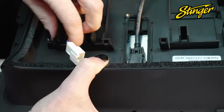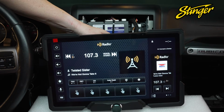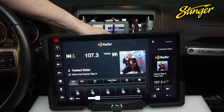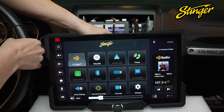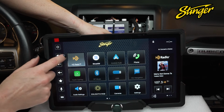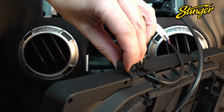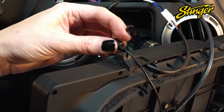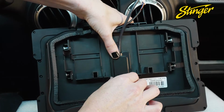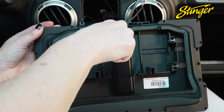You can place the foam from your IX212 radio box on your center console, so you have a place to put the 12-inch screen while making the connections and testing that everything works. Once we know everything on our radio is functioning properly, we can install the microphone to the bottom of the screen. Plug that into the extension, connect our waterproof panel onto the back of the video cable using the small screw to secure it in place, and then we are ready to install our screen.